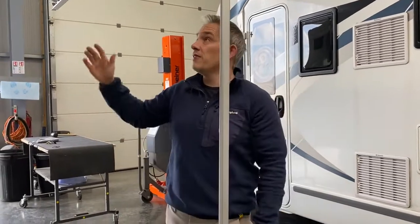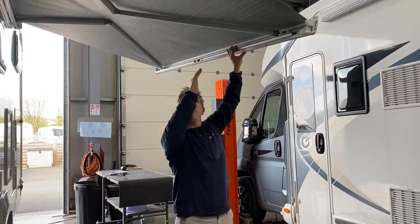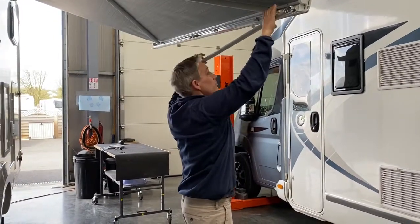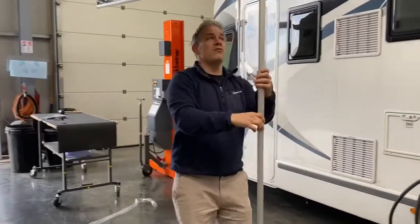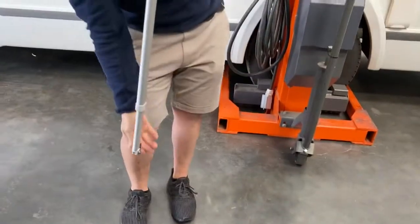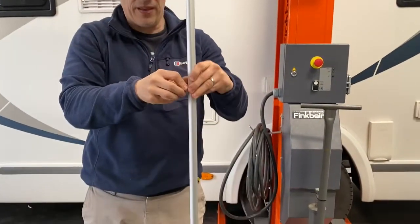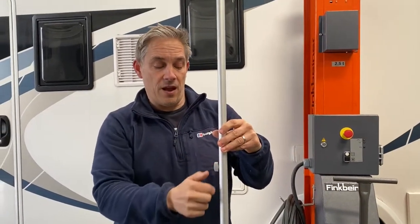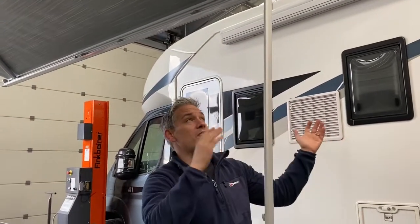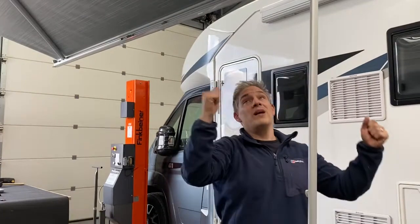You must be careful in wind — high winds can cause problems. Once the awning is wound out, grab the right-hand side of the awning leg and pull it towards you — the leg will come out. Rotate it around and there's a little wind-down adjuster to set the height of the leg. Make sure the foot at the base is flat. Drop it down and set the awning to the correct height, then nip that up to ensure the leg doesn't drop. Wind it out to two and a half meters; if the canvas drops and goes droopy, wind it back in a little to regain tension.